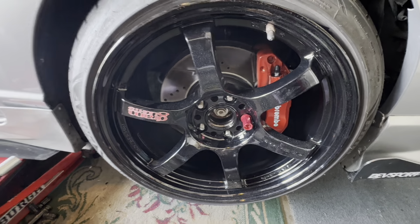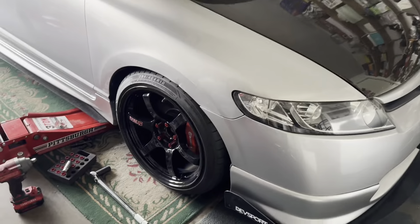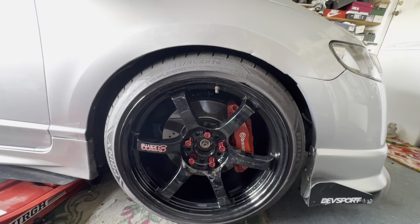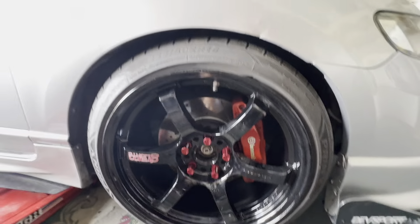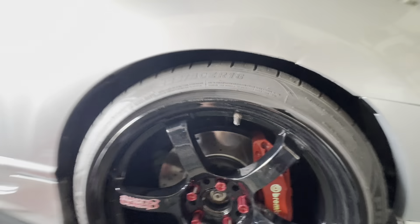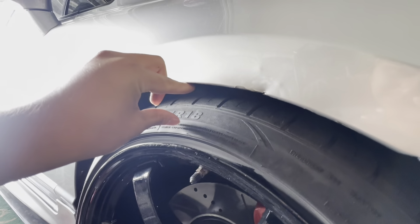Here's what they look like right now. It looks like I might have to go a little bit lower on the coils, but it's not even poking that bad actually. I might only have to add like half a degree of camber to make these work. I love these wheels — I do have the center caps, I'm gonna put them on after I finish installing all the wheels. I've got like a one finger gap solid, but I do have plenty of clearance, and if I add a degree of camber I could probably drop it another inch.